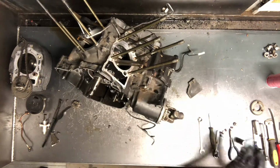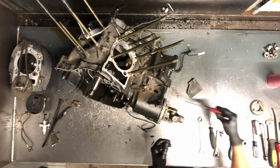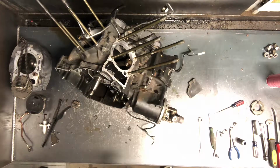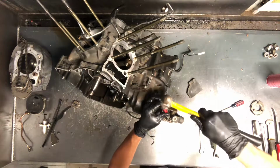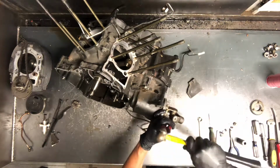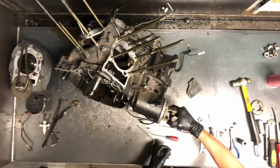back drive yoke here. And what I do is I grab a smaller screwdriver, and you're going to take these clips off, this one here and this one here. Take the screwdriver, find the end of the clip here, and tap on it. Now sometimes that clip's just going to spin around there. So you take 2 of the same screwdriver, same size, and tap on both sides of that clip, and it'll just pop right out of there. Do the same thing on this one.